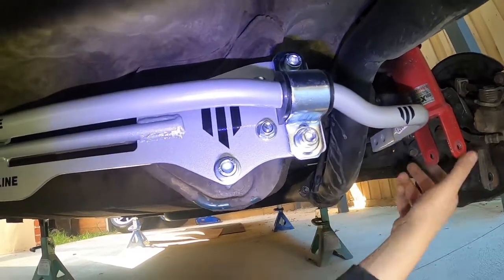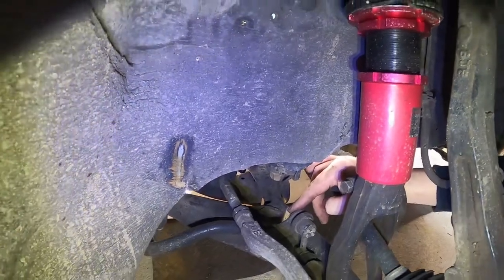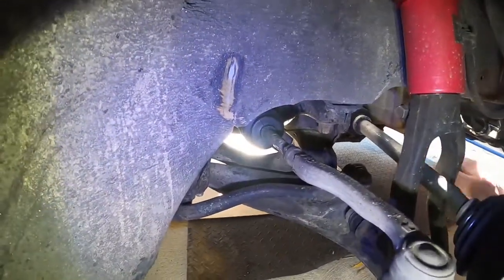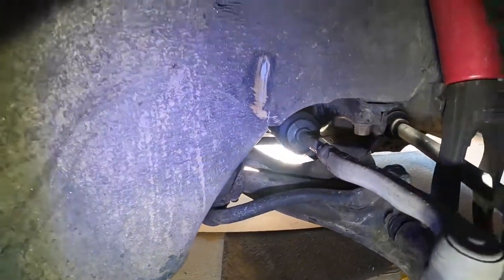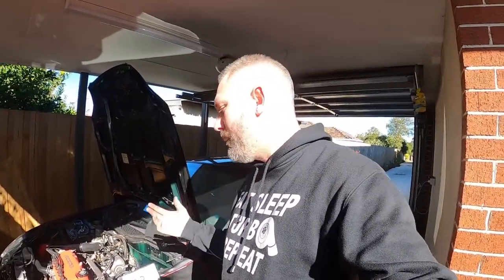I'm not going to be defeated, so up to the front we go. The front one looks like it's a little bit more simple. We do probably have to drop the exhaust, but lucky I put those V-bands in there which means there's only one bolt to undo. There's a 14mm nut on the back of the sway bar attachment, and then there's two 12mms down there to undo. Working in a carport again — a different one this time, but still a carport just like the old place.